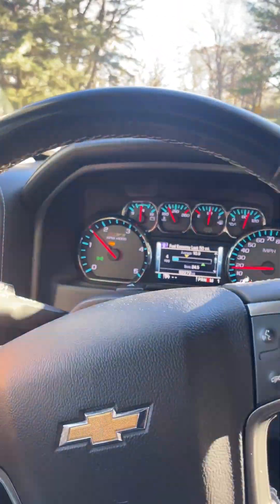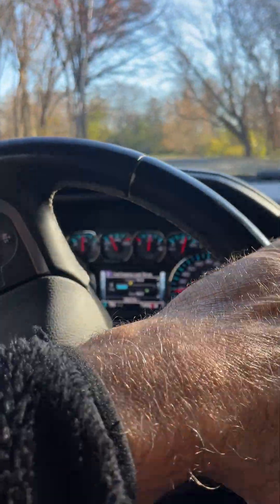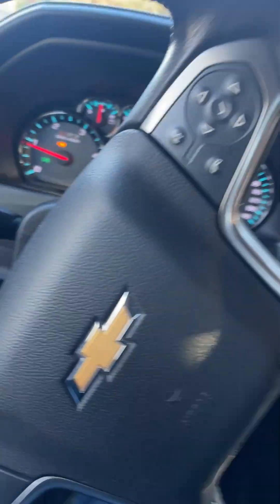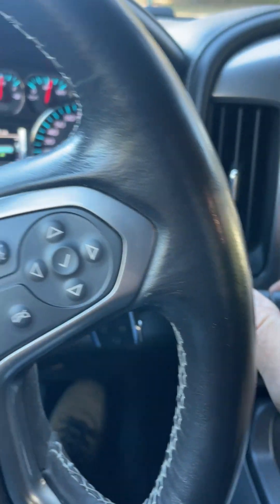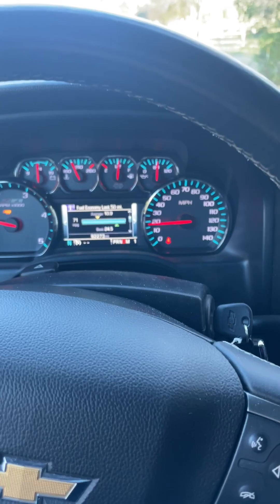If I'm going downhill — a long downhill — I don't go any faster than 50 miles an hour, such as coming through a mountain pass, so I can always stay in control and won't overheat my brakes. I can also engage a lower gear. I can move the truck into manual mode and downshift using the downshift button, and just roll down in a lower gear going down a long mountain grade.